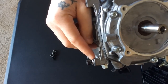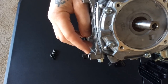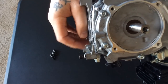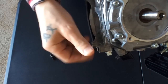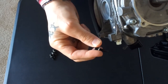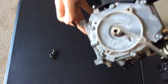Keep in mind there will be the mounting bracket, which is about under an eighth of an inch thick, so it's still going to have some play in here. We're going to add a couple washers and then Loctite to make up the difference. Another way you can do it is cut it down — put it in a vise and then take a hacksaw and cut this bolt down to size, cut about maybe three-sixteenths of an inch off of it, and that would be fine too.